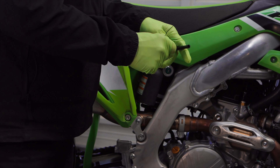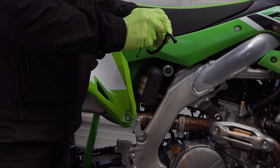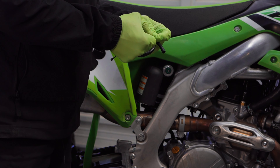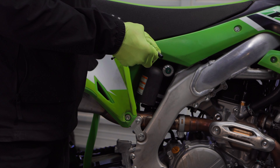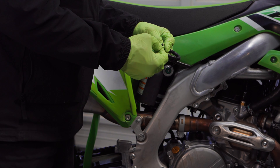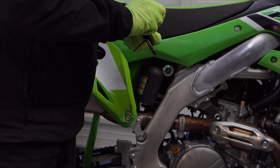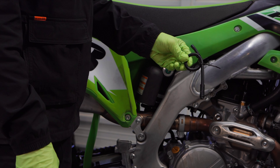While the traditional method is pump-open with the bleeder valve, if you create a little curly-Q here you can just pump straight through. Take your fuel line and zip tie it in a circle — you could also use duct tape. Or if you're a serious mechanic you could have something like this full time in your toolbox. In this instance I just use the fuel line off the bike itself, and before we put it back on the bike we'll shoot some contact cleaner through it. This keeps air from going back in when you're bleeding.